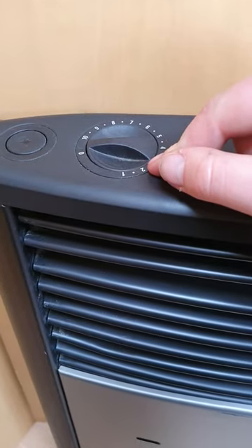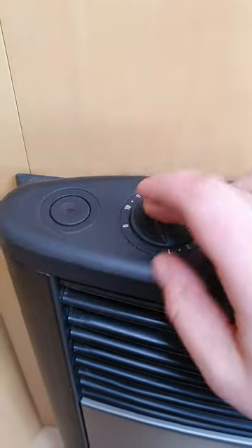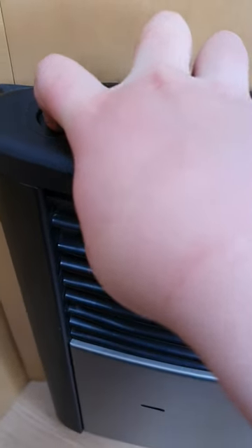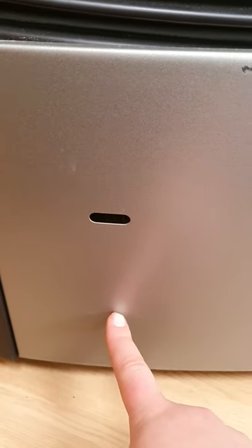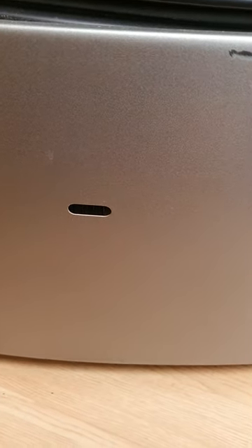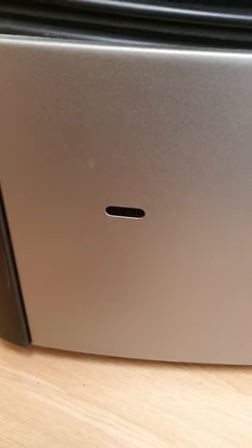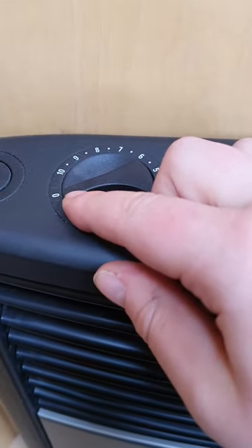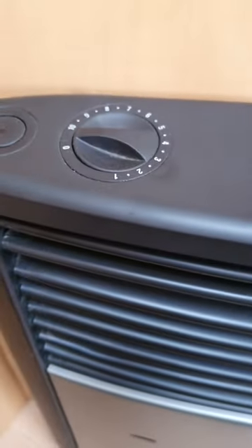On the left hand side here is to run your room heater on gas. When you go to ignite it, you normally want to turn it up quite high. Your temperature dial is also your purge button, so you're going to push and hold that in. While you're holding that, you want to hit the igniter next to it. While you're doing that you'll need to look through this little viewfinder here. Generally about 25mm in there's a piece of glass that matches the shape of this, so once you get the angle right while holding the purge button and hitting the igniter, you should see a blue flame, and then once you release that purge button it should kick into a nice bright orange flame. You can then adjust your temperature from there. When you go to turn it off on gas, you want to go to the zero and then push the dial ever so slightly past that — like you're going back around towards the 10 — and that'll shut your room heater off on gas.